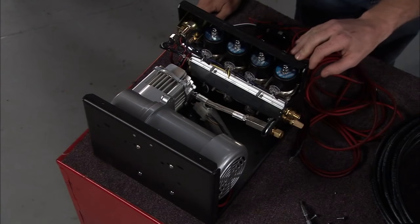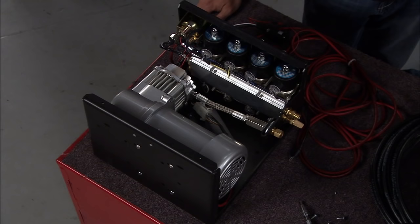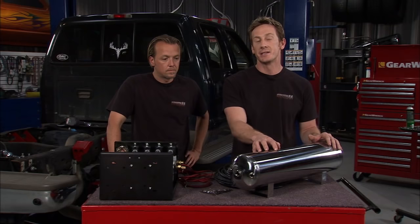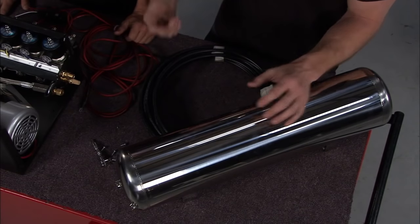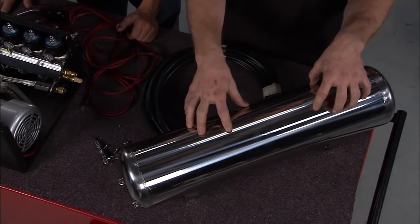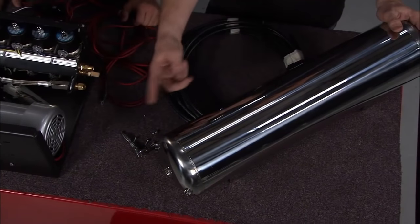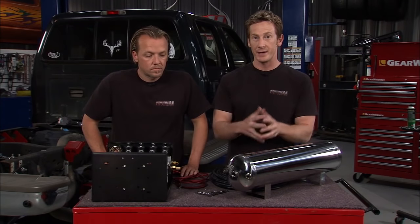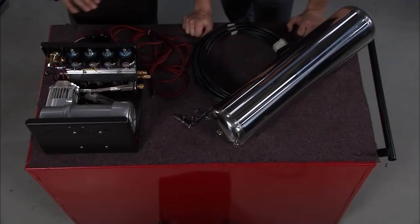This plug-and-play compressor comes with a continuous-duty three-quarter horsepower engine, so it'll have more than enough power. We're going to add a five-gallon stainless steel tank for plenty of volume. This guy also has an air horn tied in, so we'll consolidate everything into one system. There are a couple of different bungs on both ends of the tank giving you options to tie into different accessories — all we really need for our application is one in and one out for the compressor, but you can add things like a train horn if you want.